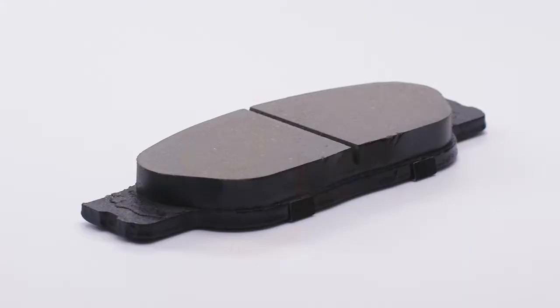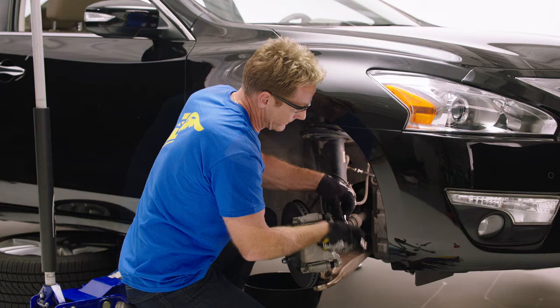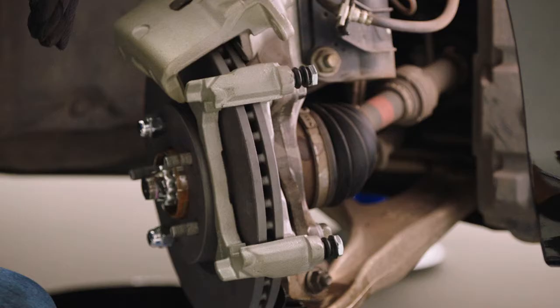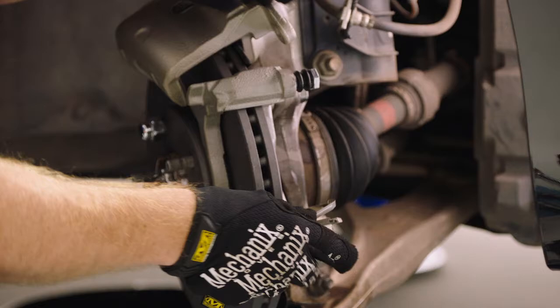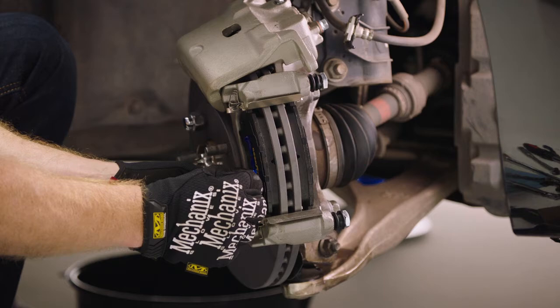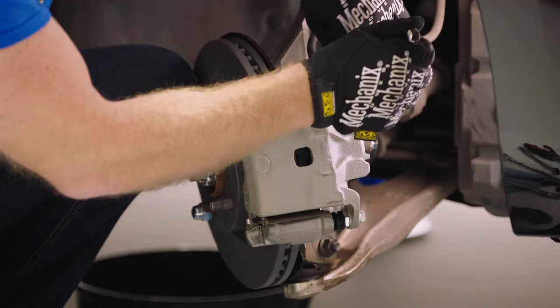Let's put in the new brake pads. Take the caliper mounting bolts out — the caliper will now lift off. Be sure to place the caliper in a safe position to protect the brake line while you work. You can use a bungee cord or a coat hanger to properly secure the caliper. Next, install the brake clips that came with your brake pads — they should both click right in like your original caliper. Now you can put each of the brake pads into place. We're going to lightly apply a little grease to the back of the pads between the pads and the calipers. Then replace the caliper, replace the bolts, and tighten it down with your ratchet.